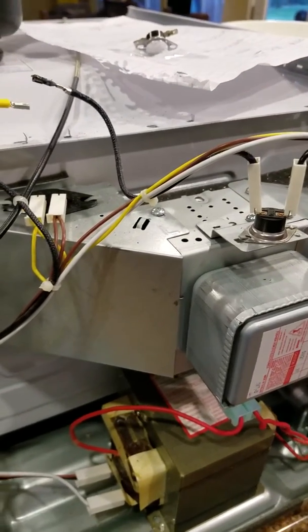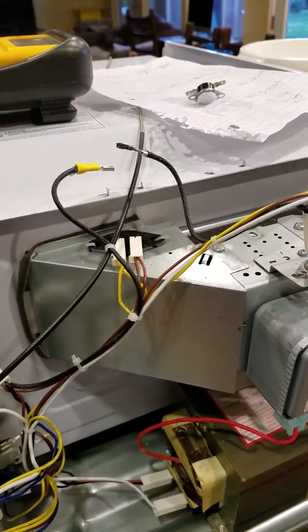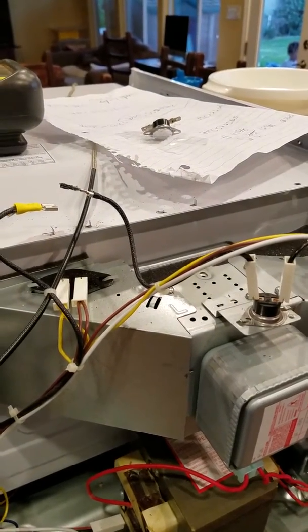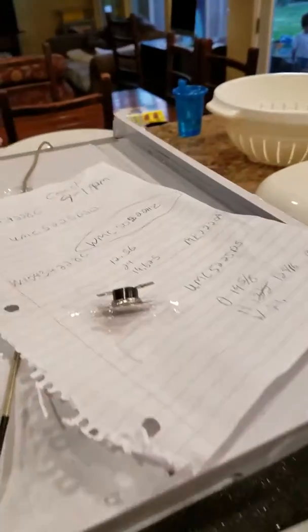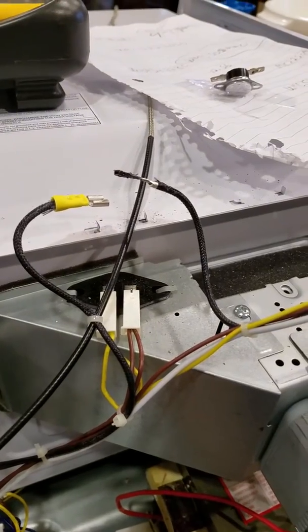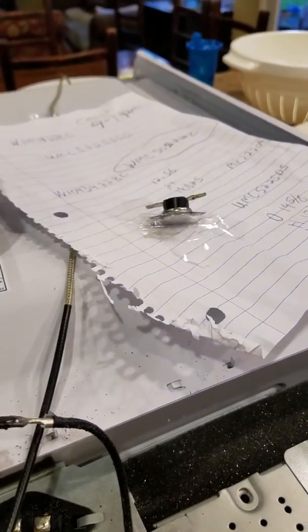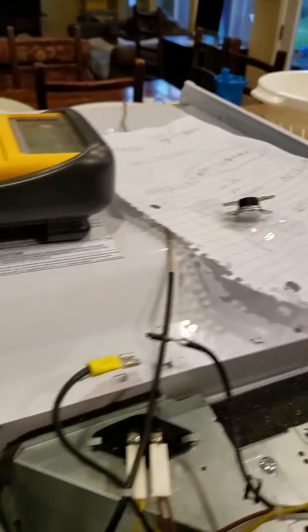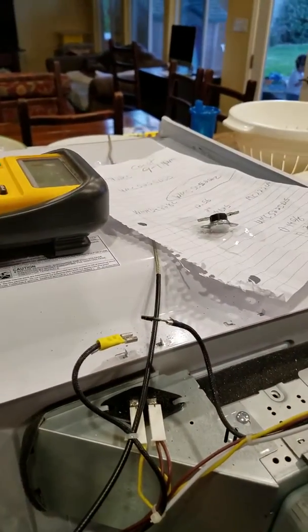If you go a higher rating and you do have a situation like what was going on here, popcorn was constantly getting burned in this microwave and causing almost a fire. So basically overheating the microwave, and it popped this thermal fuse. And once a thermal fuse goes bad, it can be intermittent, because it's just a wire or resistor in there that'll basically pop. And if you joggle it enough, or slam the door a couple times, or hit it with a screwdriver like I did, I kept tapping it and it would come on and it would work.